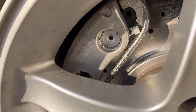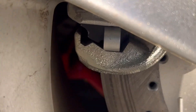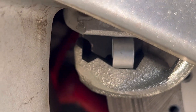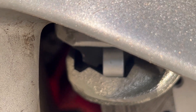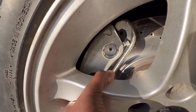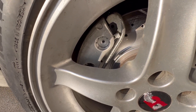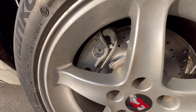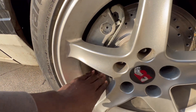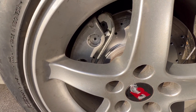Hey, you live and you learn. The brakes are there but there's supposed to be a pin that goes right there and as you can see it's not lining up. That's causing the caliper to move, and the other day when I drove it around the block after putting everything on, I noticed the caliper was literally riding on the inside of the rim.